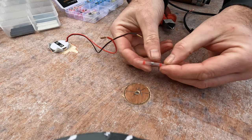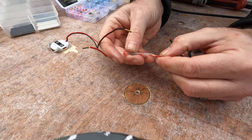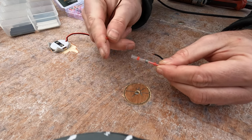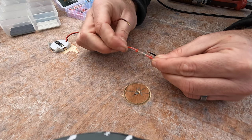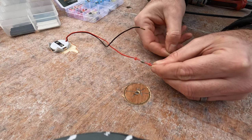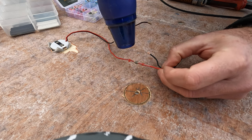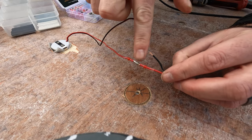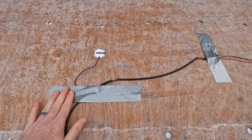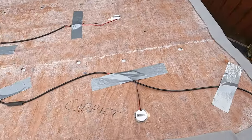Be careful - these things are brilliant. Inside you have a little solder coil, but you've got two glue ends which glue the wires together, seal it, and it heat shrinks as well. Get the wire and just push it through, run it to the middle, then get your next one and straighten the edge up. So that's all the wiring done on there - just take these down so they don't flap about. The tail end here will join up in the cab and then I'm ready to put it in.